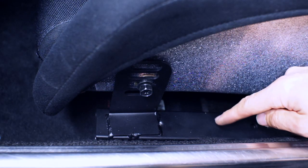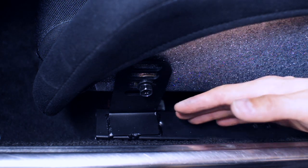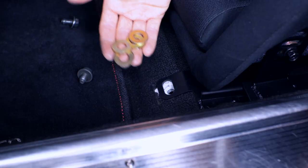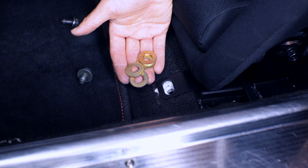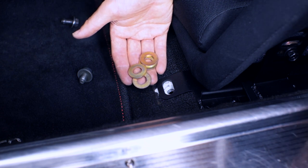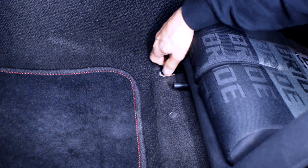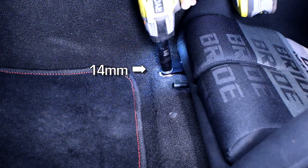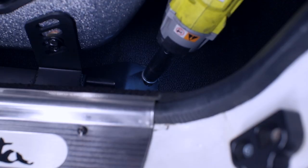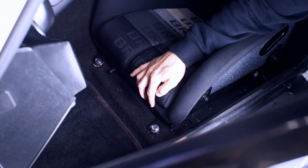I'm having some trouble with the outboard slider making contact with the vehicle's chassis right about here — that's preventing the seat from sliding forward and backwards smoothly. The seat rail kit comes with a number of washers. I'm going to use two each on the front two corners to shim up the bracket, hopefully providing enough clearance for the slider to work properly. And since the bracket has slotted holes on all four corners, I'm going to push the seat in towards the transmission tunnel to make clearance on the outboard side. Let's not forget to torque these down properly on all four corners to 37 foot-pounds.